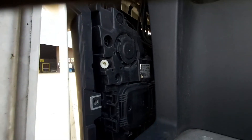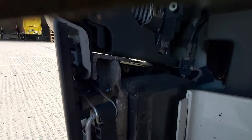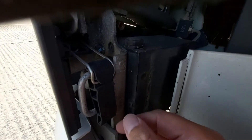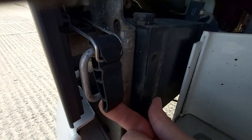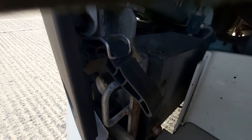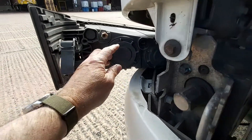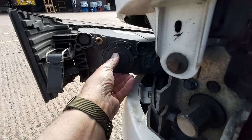With the backing plate removed, go down to the bottom. To get access to the front fog light you'll find a little black plastic clip here that just clips forward, and that enables the whole assembly to move forward and you get access to it by removing this plastic cover.